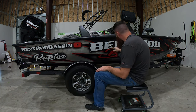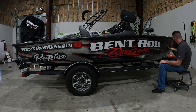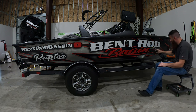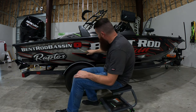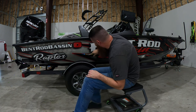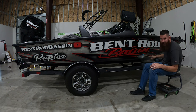Pretty much what I'm doing is just getting the wrap nice and hot — I'm looking for any air coming up. If there is, we're going to get it down. For the most part it looks really good — not seeing anything popping up, wrap's nice and tight. You really, really, really want to make sure you get your edges post-heated — edges are probably the most important spot for post-heating so you can make sure that wrap made a nice solid contact with that primer.